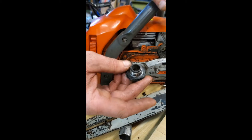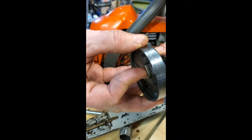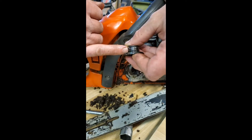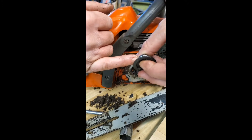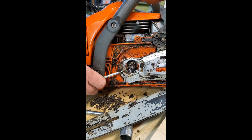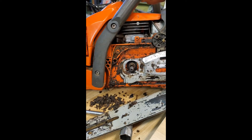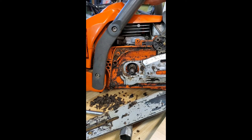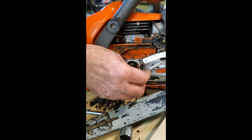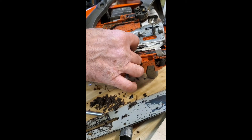This is my oil gear. The clutch drum fits into those two grooves in the gear. This metal band becomes the teeth for driving the oil pump, which is right here. As it's spinning it's turning this - it's a simple pump, basically an opening and a closing with a valve inside. As it spins, the opening allows oil to come in, and as it closes it pushes the oil out a different hole and eventually up through and out this hole here. A simplistic design, but invented by people a lot smarter than me.